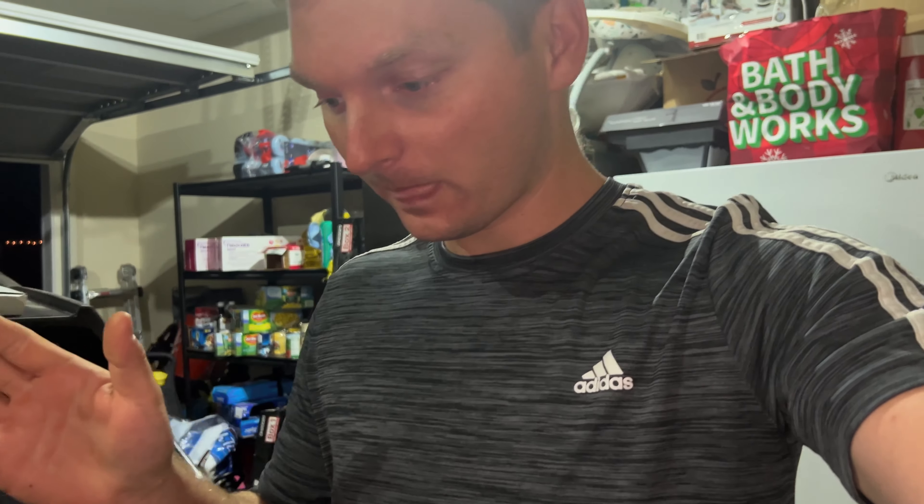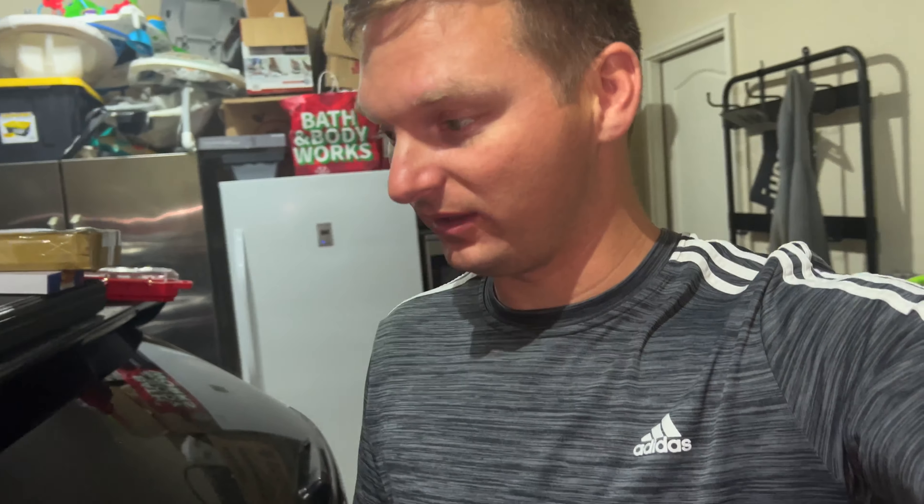The shop said they're doing like an entire valve job, which means they do valve lash and pretty much everything. So I've got to double check to see if they're going to measure poundage on the springs and the spring rate just to make sure they get the lift right. I have a crap ton of extra valve buckets because the OEM W25 head I bought came with a whole fresh set of springs, buckets, valves, and OEM cams. So I gave them all that, and they should have enough sizes to hopefully get those cams all situated.